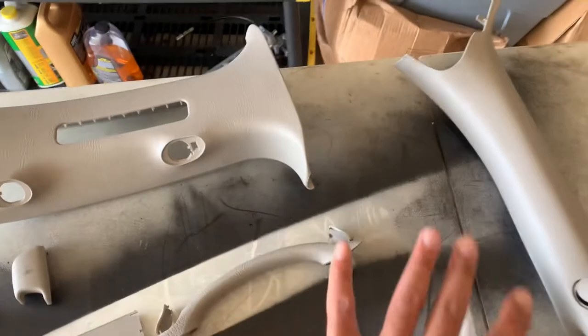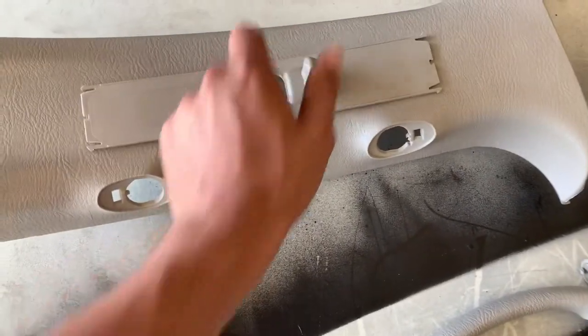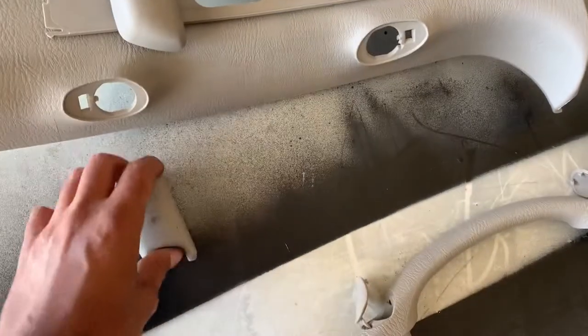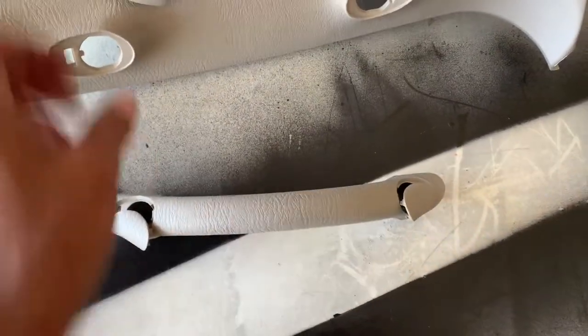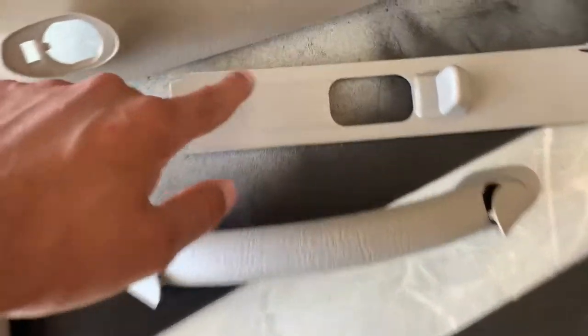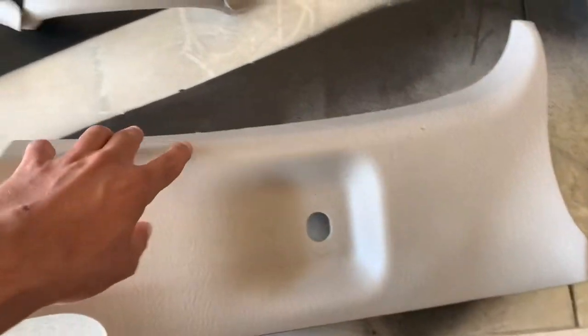To keep things simple, here's the entire passenger side: you've got the hook wrap handle, then the B-pillar — the one with the passenger seatbelt sleeve that lets you move the belt up and down — then the seat belt cover, the rear seat belt cover, and the B-pillar handle for the rear passenger. It's best to do it in a couple different pieces: clean everything, dry everything, get some heat on it, prime everything, then paint. Here's also the C-pillar in the rear.